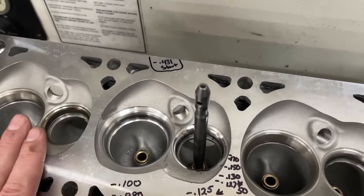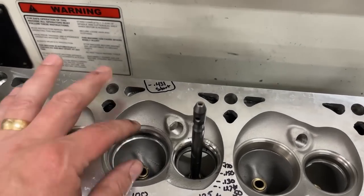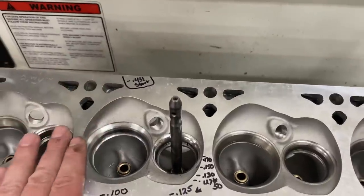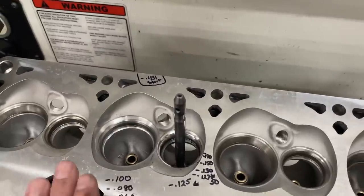The valve will not conform to a bad valve job even with a good spring on it. Regular springs will take up some of the slack if it's a little out, but if you've got enough that it's coming through here, the spring will not make that up. One of the tests I like to do - and I need to back up and point this out - is...